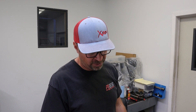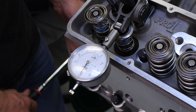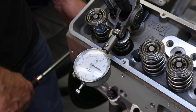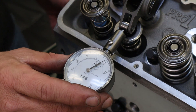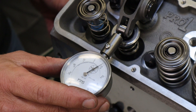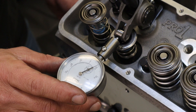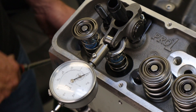We've arrived at our final geometry and push rod length. We've lengthened 200 thousandths from where we started, putting us at 8200, and we'll run through a final sweep. On the opening side we have about a 50 thousandths sweep outward at half lift, and at full lift we're about 8 thousandths from where we started — pretty close. Based on push rod availability we're going to stick with that 8200 number, then back out to 50 and close.